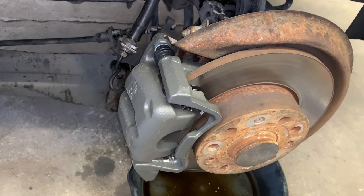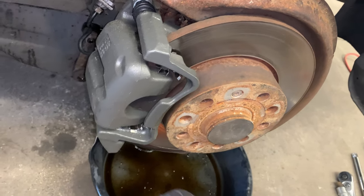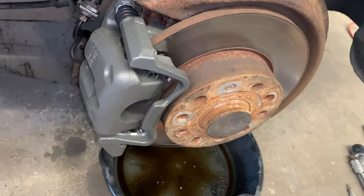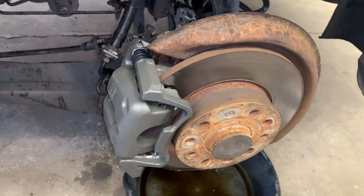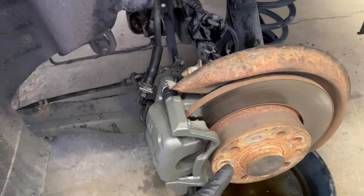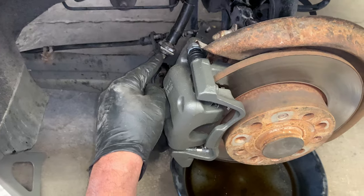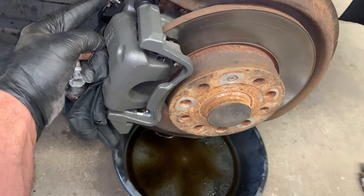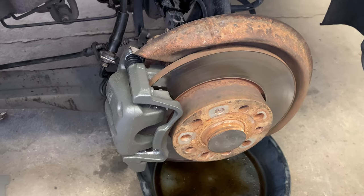That's how you do a driver's side rear caliper. I might have to replace this one more time since it's the AutoZone one — I don't feel like paying $150 for a new one when this is under warranty, and I got into a pinch on the road. So to recap: two M14 triple squares, an 11mm for the brake lines, a 13mm for the sliders, and a pair of vice grips for the clip and the e-brake cable. Hope you enjoyed it — see you in the next one.